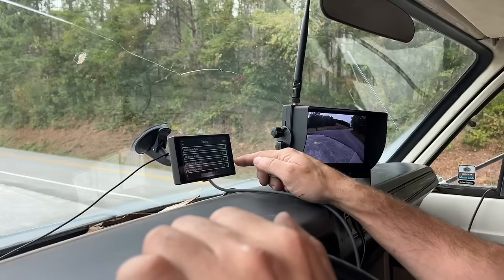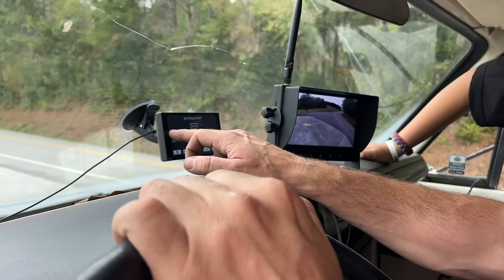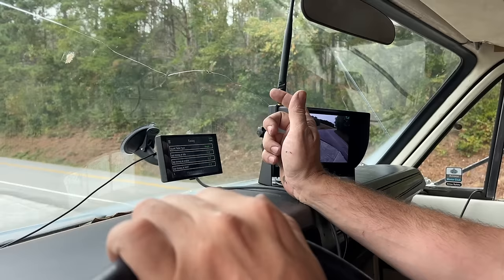See, I have 36 degrees. This was at 26 degrees and I changed it. You can't leave nothing alone. I know, I bumped the timing. Let's turn it down to like 28 or something. That's wide open throttle, so it's gonna be under a hard load. We'll turn it to 27 at wide open. I noticed once we got above like 34 degrees, it was dinging. So we'll go down to like 32, take a few degrees of timing out of it. We'll try that and see what it does.